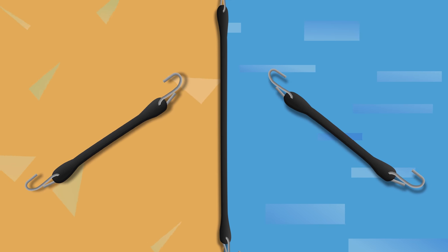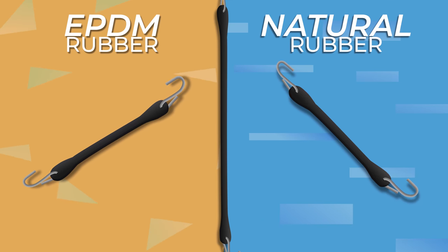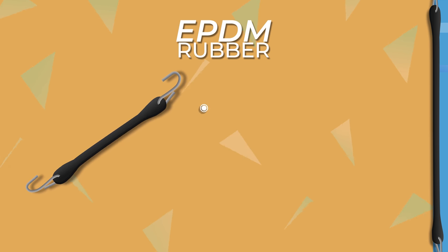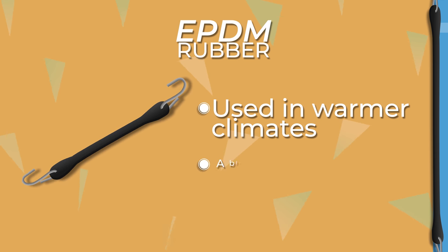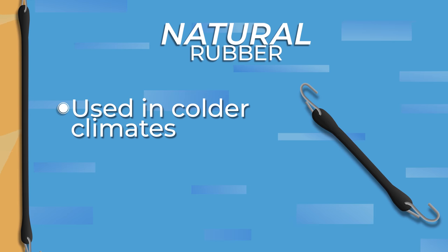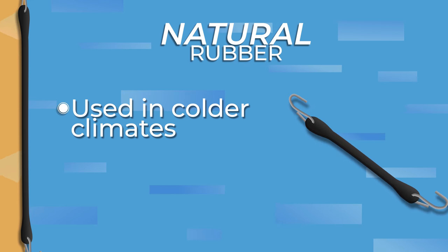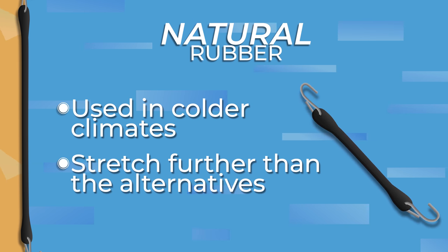There are two basic styles of snap strap, EPDM rubber and natural rubber. EPDM is a synthetic rubber that is typically used in warmer climates, since it has more elasticity and is able to resist dry rotting, which often occurs in the heat. Natural rubber handles lower temperatures and resists breaking better than other types. So it's often preferred in colder climates. It has a lower freezing point and will generally stretch further than the alternatives.